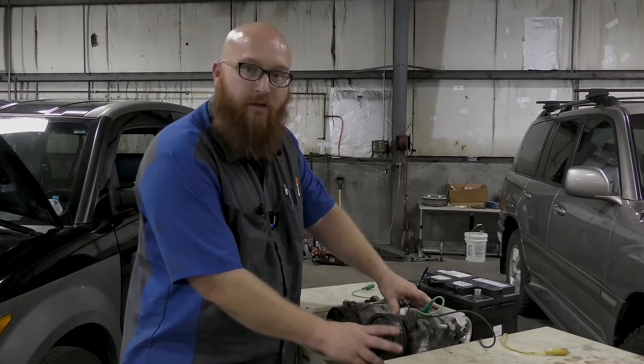Yeah, we just did that actually on this Honda. We checked at the relay. We put power to the compressor. From that relay, it goes right here to these wires. That's why we heard it click back and forth when we did my little manual relay. We proved that it clicks on the clutch, it works. We can also prove, is the computer telling it to turn on? And we did prove that with the test light.